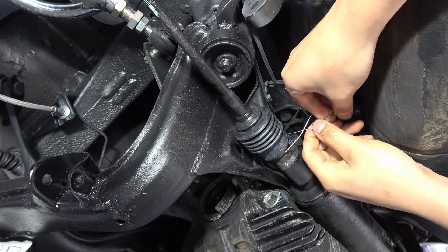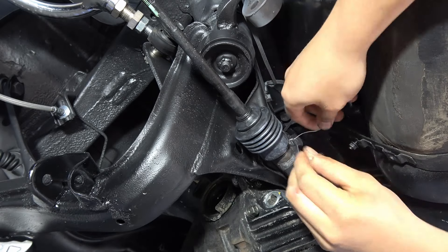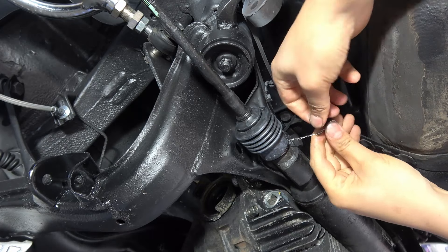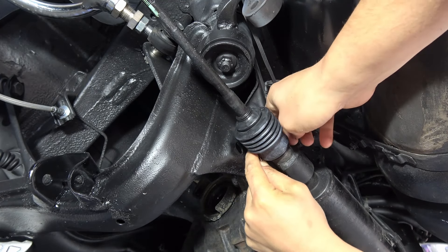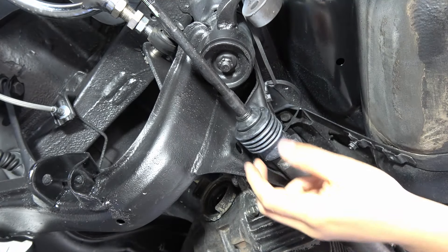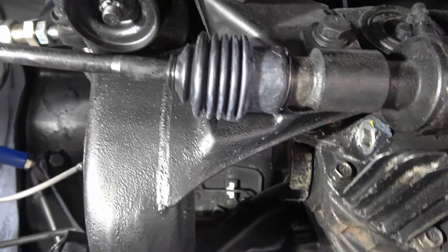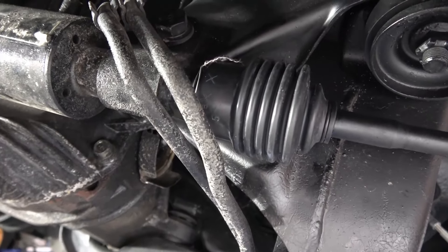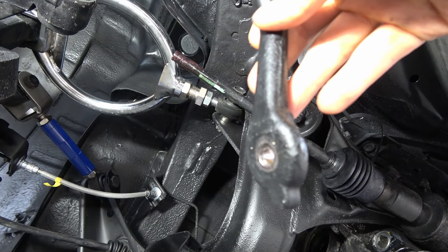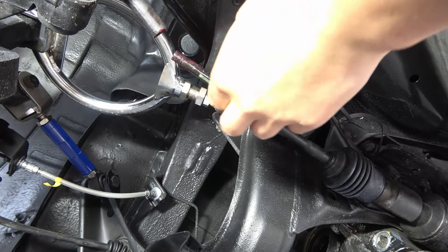You just go around once, push it up, bend it up and out of the way. Pretty simple — it looks something like that and we've got both the passenger side done and the driver's side done. We can put the tie rod end back on. The nice thing with this tie rod is there's no ball joint on it — the ball joint is actually on the knuckle itself, so at least this will be a part that doesn't have to be replaced.